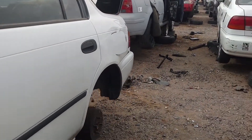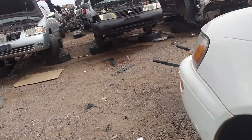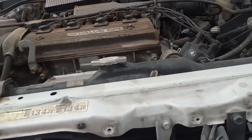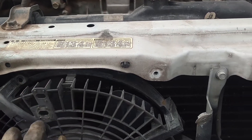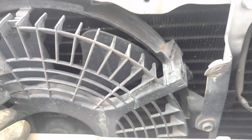I think it's a Toyota Corolla 2004. Oscar needs a fan from it. It's got a few Phillips screwdrivers to take the grill off, and a few 10 millimeters. It's got a couple of 10 millimeters where you can't really get a ratchet — that one right there, may be one other.